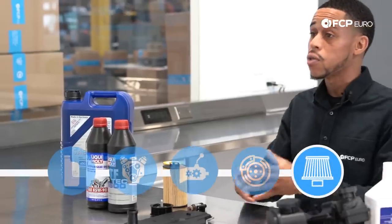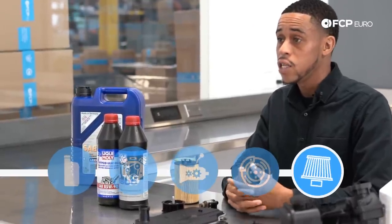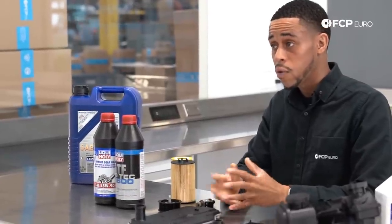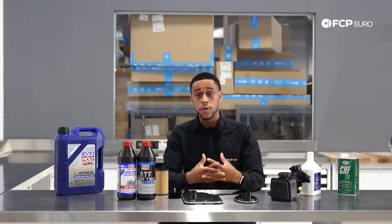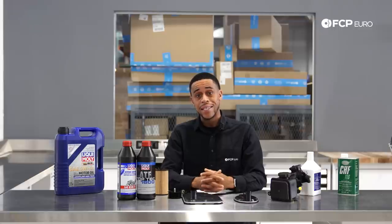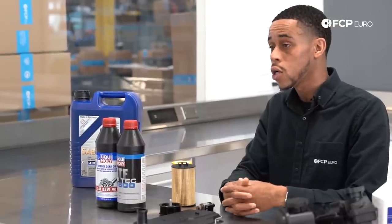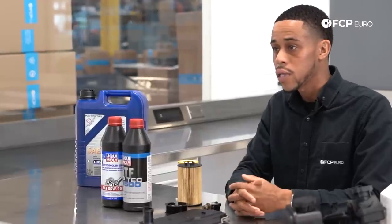Lastly, I want to talk filters. You should be replacing your filters every year. The engine air filter comes as a filter set, so you're going to have two filters regardless of the platform. If we're talking cabin filters — the filtration for the air you breathe in the cabin — some models have a single filter in the engine room. I'd recommend replacing that at the same time as the engine air filter, which is about every year. Pre-facelift models also have two additional charcoal filters right next to the blower case — consider replacing all of those at the same time.